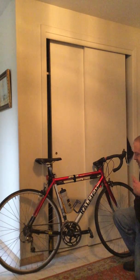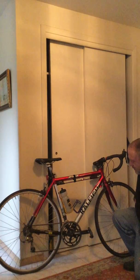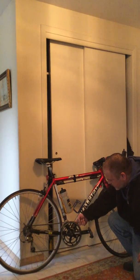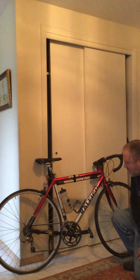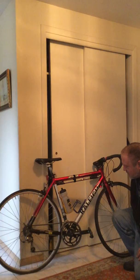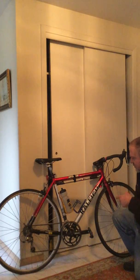And over the years, especially back in like 08, 09, when I was slimmer and younger, and some of the rides we were doing were really crazy hills, I began tweaking the gearing. So the first thing I did was I changed the granny gear on the inside of the triple. It's got like a 28 now. That's taken off a mountain bike. Second thing I did was I changed the inside gear from a 42 to a 39. So it had 52, 39, and then a really small bailout gear.